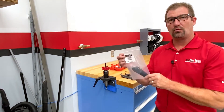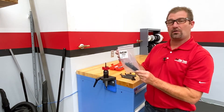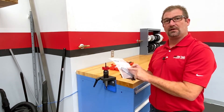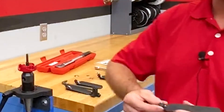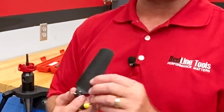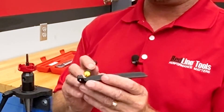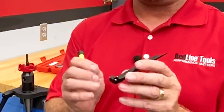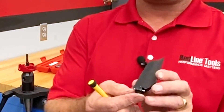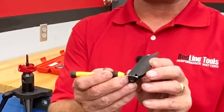For your repair, we're going to have a kit available — RTF-10 RK4 — that will come with four brand new blades and four brand new springs for your assembly. When repairing your fan, you're going to want to make sure that the pin that holds the spring is in a horizontal alignment with the pin that's on the fan blade. A small screwdriver can be used to orientate that.